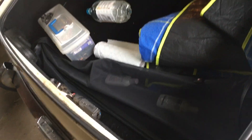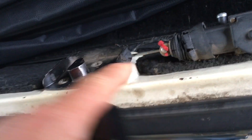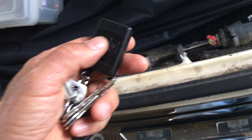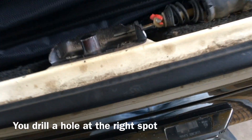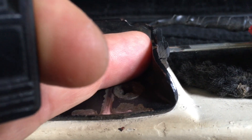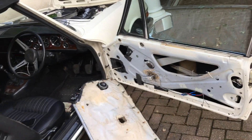Here's a quick add-on for how to add central locking onto your boot. Here's that central locking motor again. A dead easy way to lock a boot lock is to drill a hole through the side of the lock — you can see this piece of plastic goes down into this piece of metal. All you need is the rod poking through from the side, so that when you lock it the rod pokes through and sticks in the hole in the plastic, and there's no way the boot can open. I've added a tiny little rubber block just to make sure the rod doesn't fall out. Quick to fit and makes your boot secure. Wire the central locking motor up to the same wiring as your doors. Good luck with yours and thanks for watching.